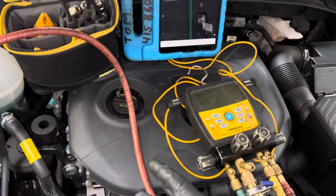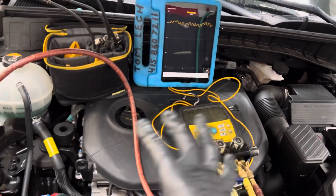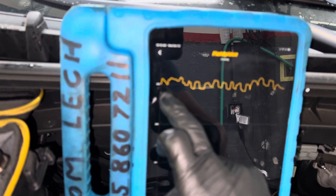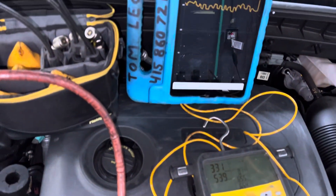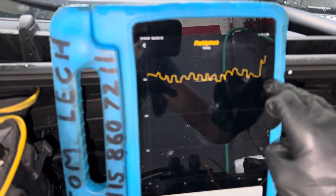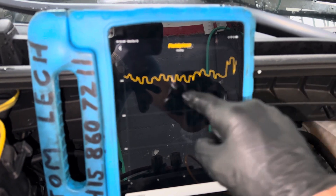In this situation right here, it's only by being exposed to readings over and over again that you'll start to see patterns. As we're pulling vacuum, you can slowly see that we've been dipping under 300 microns — but if we go back, we were up and over 300 after about 10 minutes of pulling vacuum. Our average is starting to get below and right on the 300 line with intermittent purges every now and then. As this keeps going, it'll keep going lower and lower with fewer bumps.